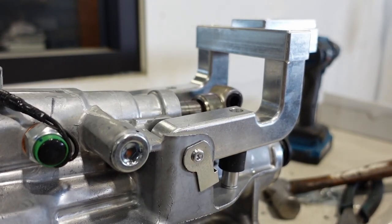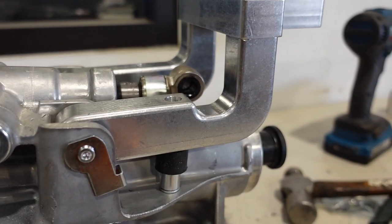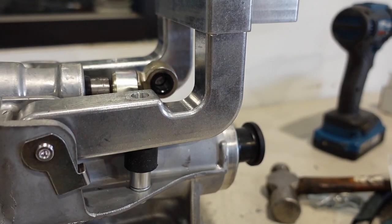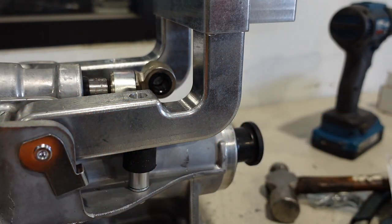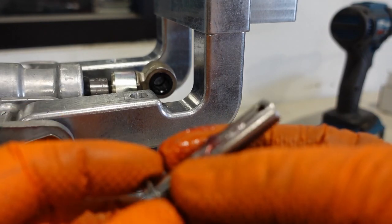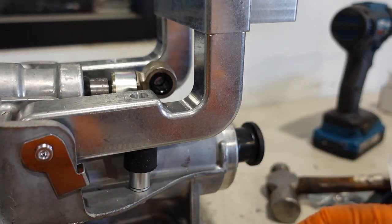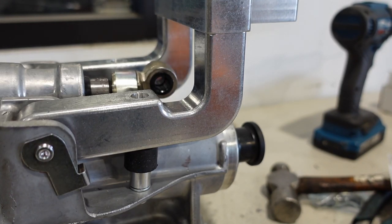Now it's time to connect the shift link bar. You'll notice a small U-shaped machine recess on the driver's side of the shifter base — this allows for in-vehicle servicing and lets you slide the pin in and out from inside the car. We have a small run of brackets that don't feature this recess; if you have one, you can machine or grind your own recess in, send it back to us for machining, or move forward without it. It's not a deal breaker for installing the link bar.